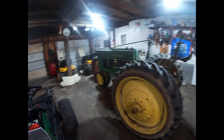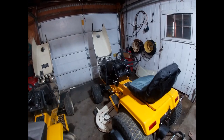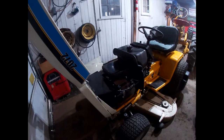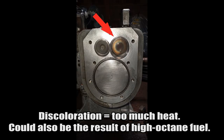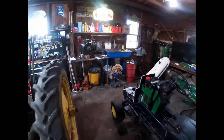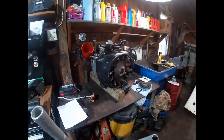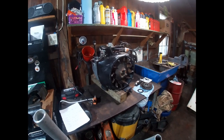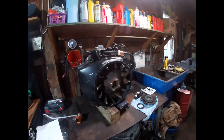I'm not just saying that — it's from experience, because I've had a few of these apart and I've seen what excessive heat can do. Over the winter when I had the engine out of my 2072, once I decarboned the heads and valves I could see some discoloration on the valve surfaces, which tells me the engine overheated at some point. That's most likely because somebody was not running wide open throttle or did not keep the cooling fins clean, which allowed the aluminum block to warp a little bit.